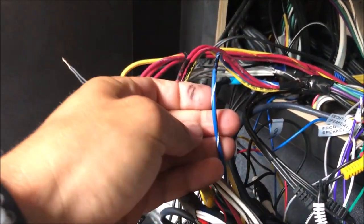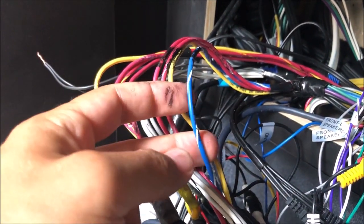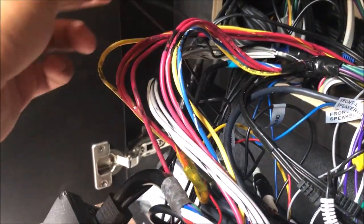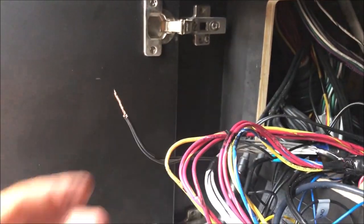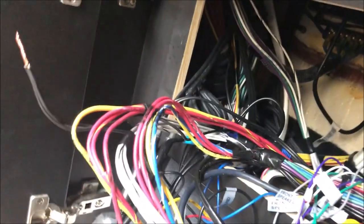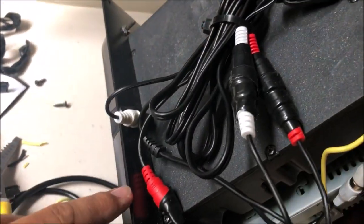Looking at the manual, the blue and white is the 12-volt positive — that's basically what's going to turn this on — and the ground you can get from anywhere. I had a unit labeled ground so I'm getting it from there. To test it, you turn your battery system on, then voltage test it with the radio on to make sure you get 12 volts when you turn on your radio.